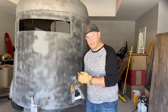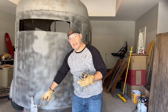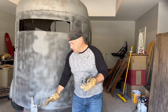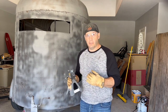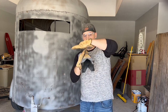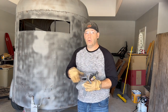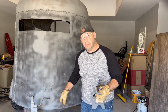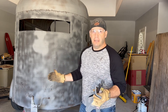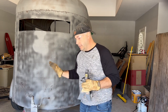So I'm going to loosen the lug nuts, and then what I'm going to do is lower this front tongue jack down pretty much as low as it'll go. Because this is a tandem trailer — and this would work even if it was a single axle — when that front end goes down, your wheels are here, and that back end is going to rise up. We're not going to use a floor jack at all — just this tongue jack. That's the only jack we're going to use.